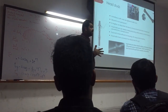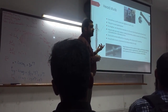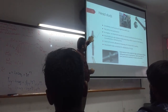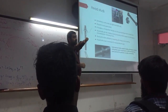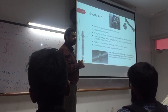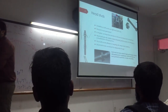In automobile engines which are not high performance, we would use bolts — because bolts are much easier to disassemble. Whereas with a stud bolt, there are nuts on both sides, and you have to hold it and tighten. If there is a torque — a twisting moment — it's basically going to tighten that stud. So most of the torque is concentrated into clamping force. Which one is stronger? The stud. So if you are talking about high performance cars, the automobiles would directly have studs which are tightened from both ends.